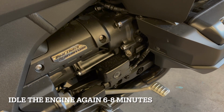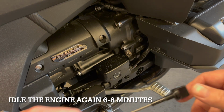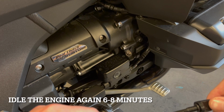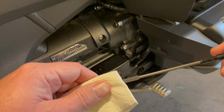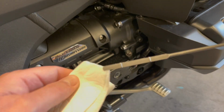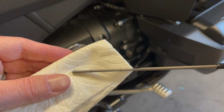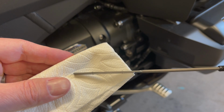Okay guys, so for these last couple of measurements, I went back and idled the engine again. I ran it for more than 5 minutes. I was concerned the oil was cooling down with all the changes in bike position and me talking and everything. Just FYI, we are still on the side stand on a 2x6, and the bike is pretty close to level. I have added almost half a quart.